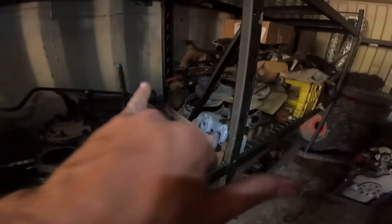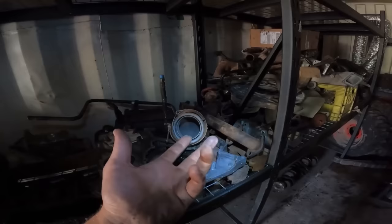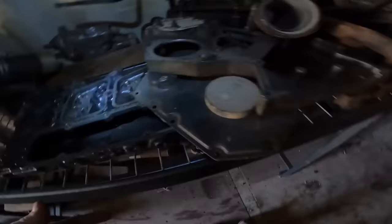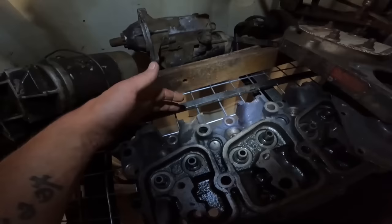So when it's been used to riding one way on the truck its whole life, and then you flip it upside down so you can have a turbo sticking through the hood, and I didn't have it planed, what happened was it heated up. I mean, brass does melt at 1700 degrees, and I melted the brass plugs out of said exhaust. So I might have gotten her a little hot. Between the heat and the torque of the manifold twisting, she broke off all five ears except for the last one on this dirty old 12 valve head.